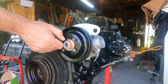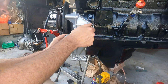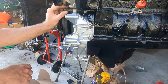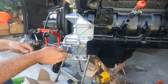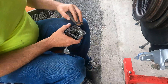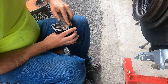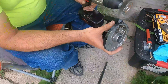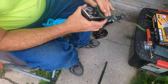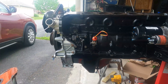We're going to put the water pump pulley on, and now we've got some brackets for our accessories. This bracket holds our alternator and also our power steering pump. I'm going to clean up the mounting surface on the oil filter housing, get all that old gasket material off and clean it up as best we can. Once we do that it's very simple — four bolts mount it right up, then torque it down to the proper specifications.